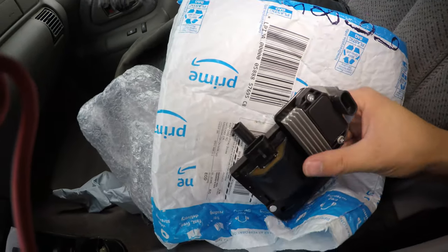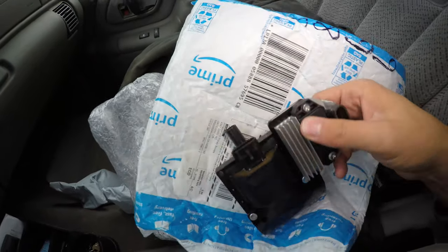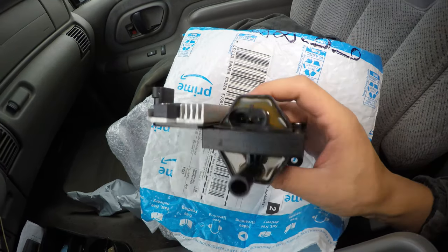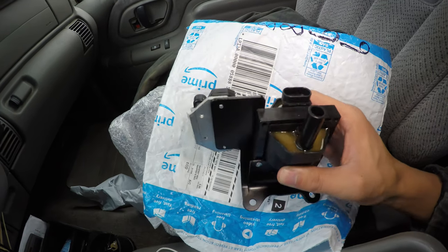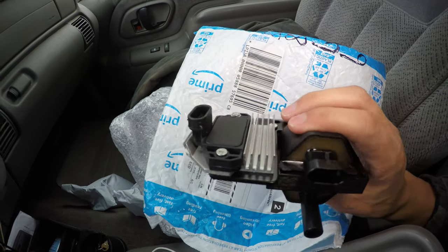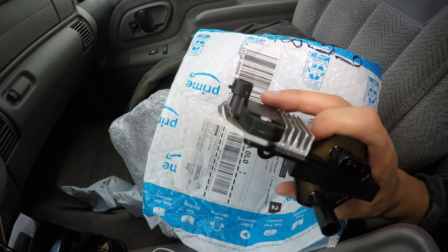Okay, so what I think is wrong with the old truck, the 4.3 liter, is this right here. There's a coil pack on here and a bracket, and then this little computer box, which, not surprisingly, GM in the 90s felt it was really important to put electronics right above the motor, just like the 6.5 diesel, where they melt, and so that's what this little box is.